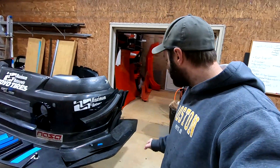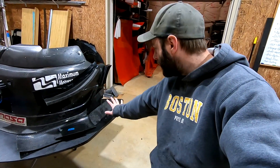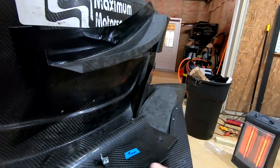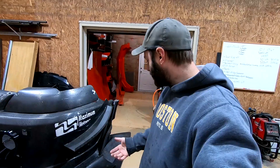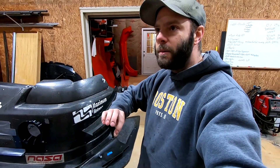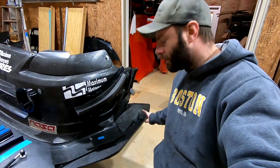If you watched our wind tunnel video — I'll put a tag up here — we removed these parts and ran a baseline with pretty much nothing. We then added a tire blocker, because as air comes down the car the tire face is right about here, and it's well known that blocking the tire face picks up downforce and increases efficiency. In the wind tunnel, removing all of this and adding a tire blocker, we lost 50 pounds versus the full setup but gained 50 pounds from the no-side-plates baseline.